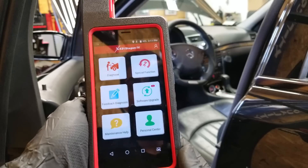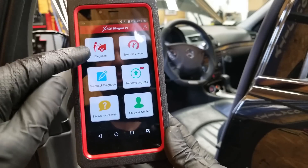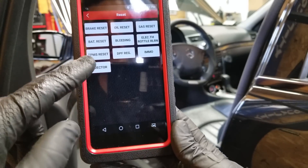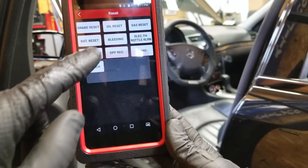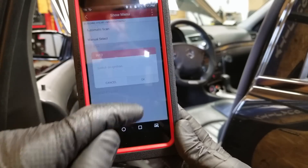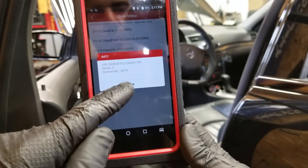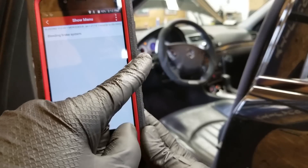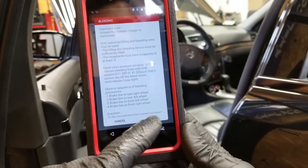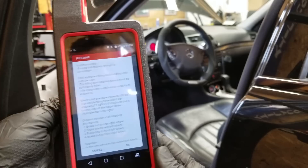You do need a special computer to bleed the brakes — you can use a factory Mercedes computer or a really good scanner. This is my latest scanner; it works on many different cars, not just Mercedes. It's easy to use — you can diagnose basically everything, read every module on the car. For bleeding electronic brakes or doing things like resetting throttle position or injector testing, you hit bleeding, pick your car, switch on ignition, do an automatic scan to read the VIN, and then it asks you to carry out the bleeding procedure, telling you which caliper to go to first. Hit OK and it activates the pump and pushes out the fluid. I'll leave a link below.